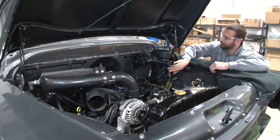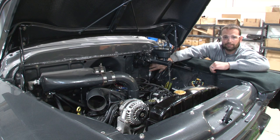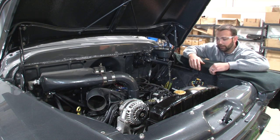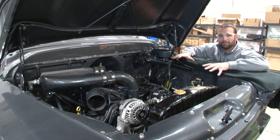We had the master cylinder reservoir painted and actually had to shorten it because of an interference issue with the hood — that was an interesting project. We put all fresh brake lines on the truck, and because of the body lift we had to extend the hydro-boost lines as well. DJ has also made a lot of progress on the wiring, getting the harness sorted topside, with a few fuse panels and the ECM mounted over here.